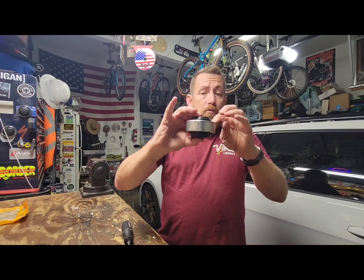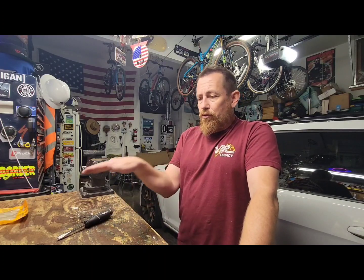Who knows, maybe it does put just enough stress on these rings that it becomes delaminated. But Superpro sent out parts. That was good. It was quick. Not sure why that happened. I really like these arms. They give me a little bit of positive caster, a little bit of negative camber. They're lighter because they're aluminum. The feel and turn-in on the track is great. So I'm going to give it one more shot. If these fail again, maybe I'll try something different.